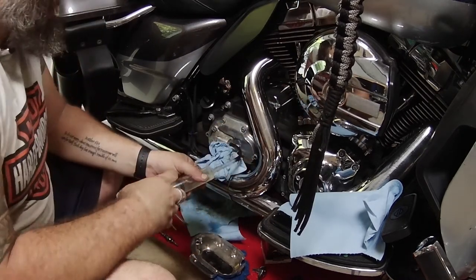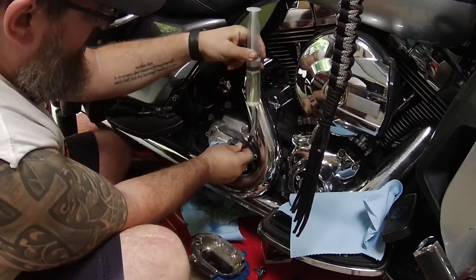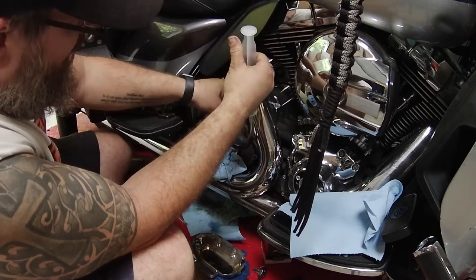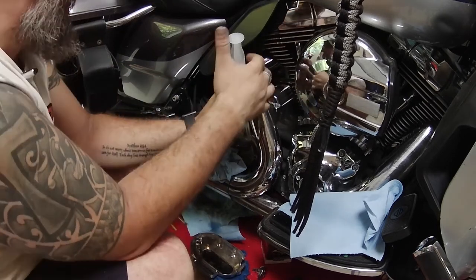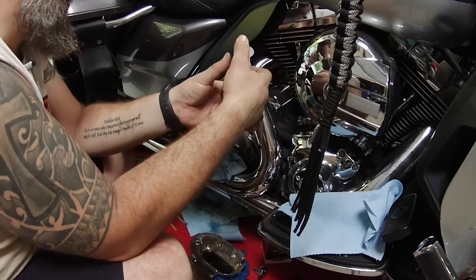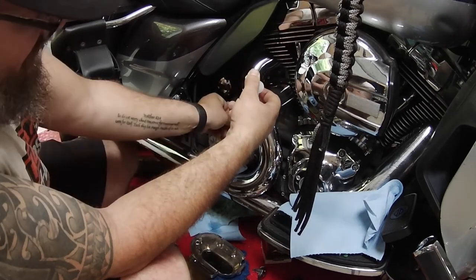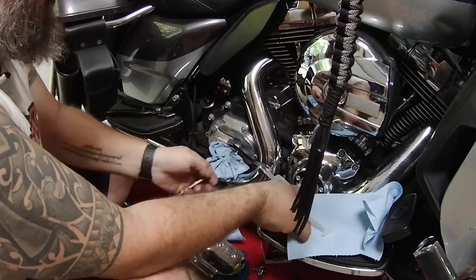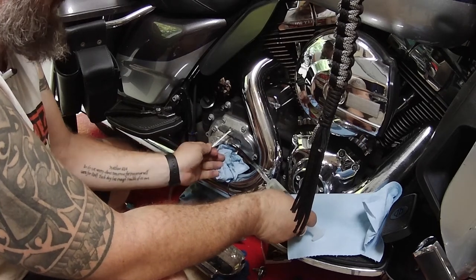Back to the other side to start pushing through a second syringe. In total I pushed three syringes through, and during this exercise I figured out half a syringe per push works out just perfect. Get your reservoir about three quarters of the way full and make sure you don't make a mess. Be sure not to push too hard — get that nipple opened up fairly well so you don't have to push too hard. If you do push too hard you're going to squirt it out the master cylinder. Gentle but firm and steady, consistent push is the key.